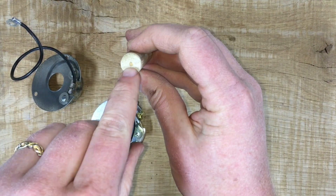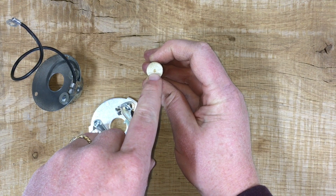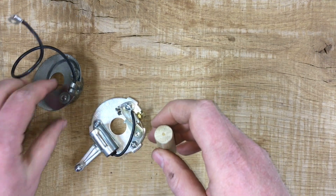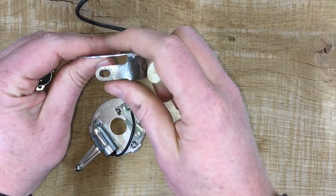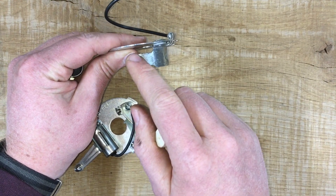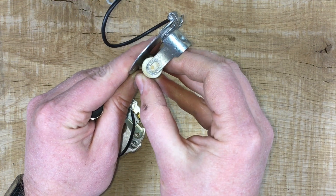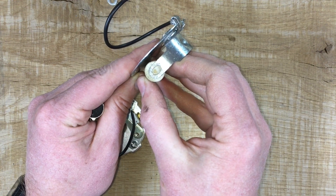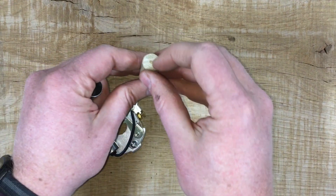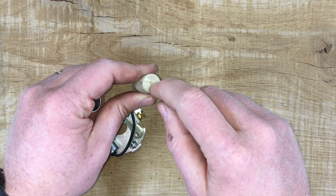I've put a little hole in the center of the dowel - it's important that the hole is in the center because that's where you'd mount a real condenser. If you aren't precise about it, the tab can end up bent toward the plate and you won't get the structural rigidity you want. So make a little hole using a center punch and drill it out.